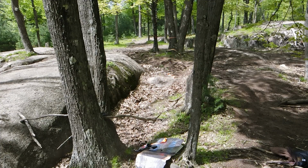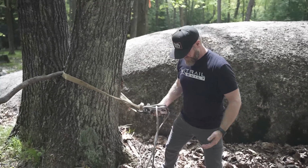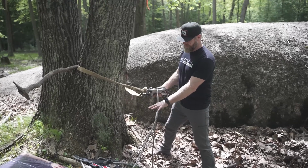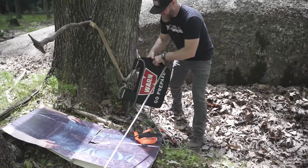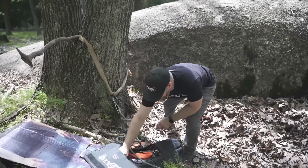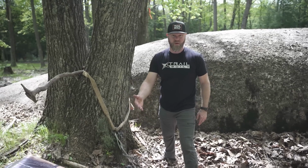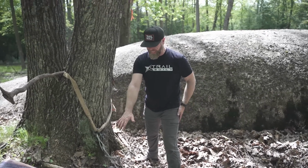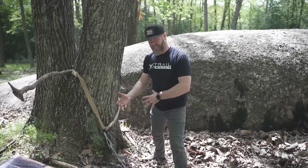This is crazy. That hook went flying even with that weighted blanket on there. It's still, I mean, it zinged. My opinion, I wouldn't even think that weighted blanket is heavy enough. Now, there are ways that you can add additional weight in here. That's what these little pockets are for. So if we thought that this wasn't heavy enough, we could always put more, like rocks in there, for example, or maybe put some more clevises inside of there. Granted, the more weight you add to this weighted blanket, the more of a projectile you're gonna have.